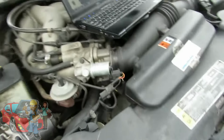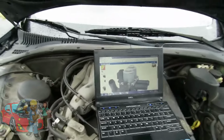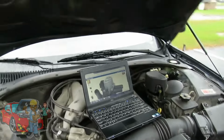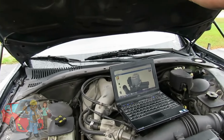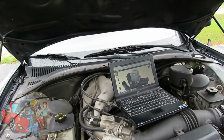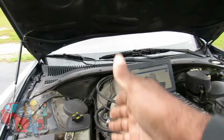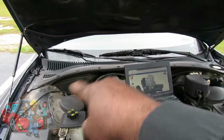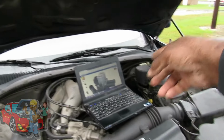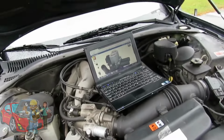So we're gonna have to get some prices up, and we're gonna have to replace that solenoid and then bleed the system again. Okay, and again, like I said, the first thing you do is check the vent doors, make sure it is operating, and it is operating. We did hear it. Check both sides of the heater core. Absolutely cold. Bleed the system. You can't bleed the system. Back down here to the heater control valve.